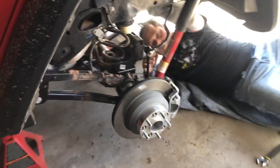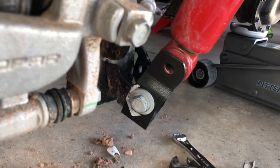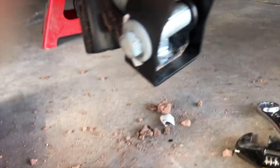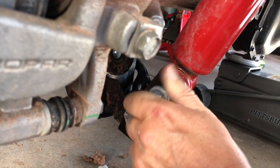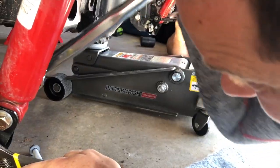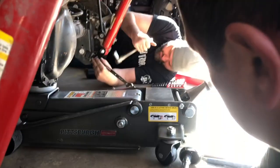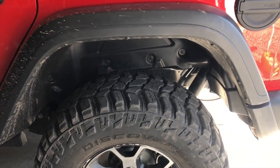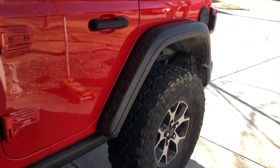Reinstalling the springs and the isolators. You're going to lower the axle all the way down, then have a friend step on the axle — it weighs more than I do. Got the rear shock extension brackets in. That bolt goes there, the factory bolt goes there. Next up is the sway bar end links — the lower half of the sway bar end links. We're using factory bolts on there. The rear setup has been installed. I'm going to turn it around. You can kind of see the difference in height between the front and the rear.